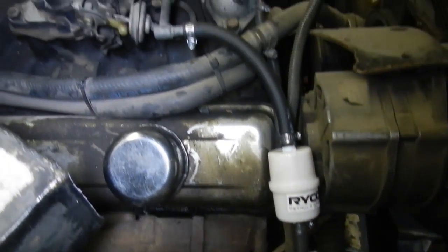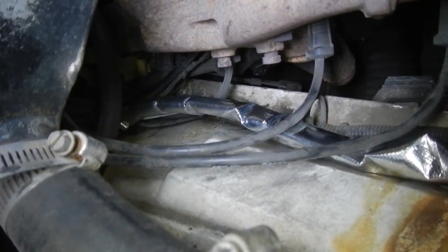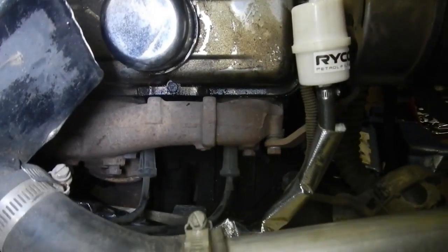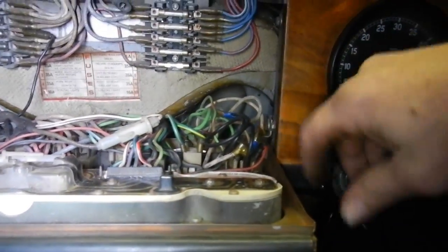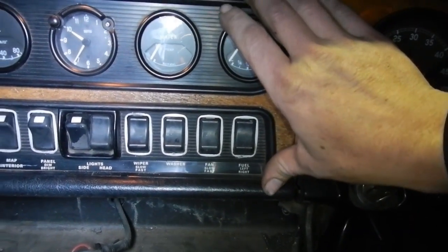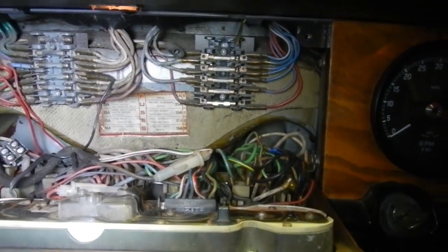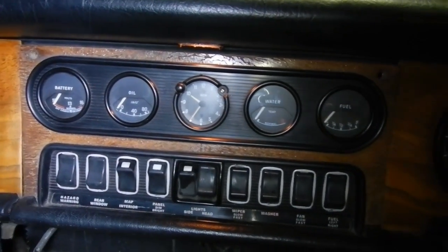And under the bonnet I put all new hose, new filter, and put the hose that ran along there in heat shield. Because there's the exhaust, there's fuel hose. The filter's far enough away from it. And the wiring wasn't too bad, I just bypassed the fuel switch because it's jammed and there's no power going through it at all. So let's put a bypass wire there for now. You can even bypass the wire for the fuel gauge, that'll work too. It doesn't work at the moment. So yeah, should all work.